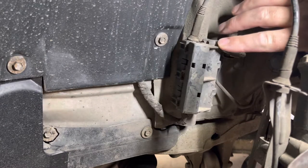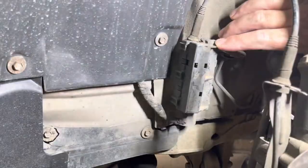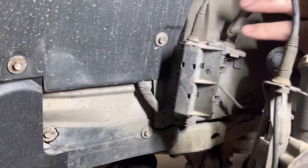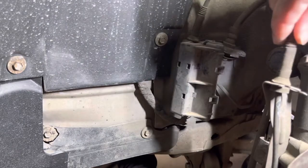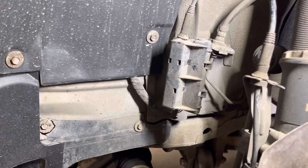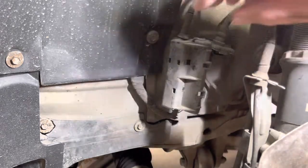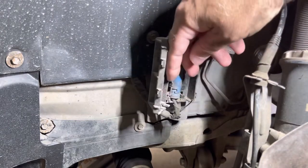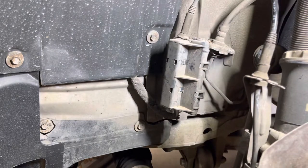This is the plug area. You open that box up, there is the blue vehicle speed sensor wiring. That's this wire right here — it goes down to the vehicle speed sensor on the hub. There's supposed to be another plug here that goes over to the brake pads. When I did the brakes three years ago on this car, I saw that somebody had just taken the two wires, the yellow and the brown, for the brake lining check and twisted them together.